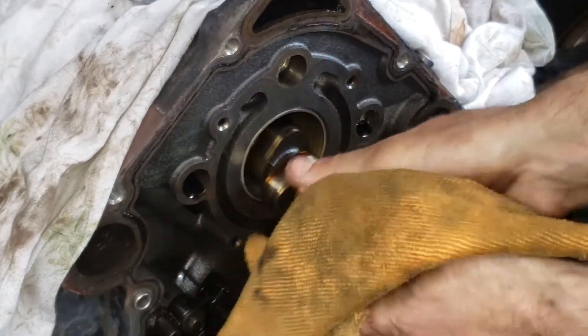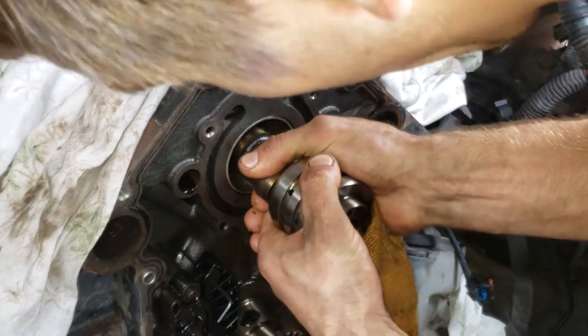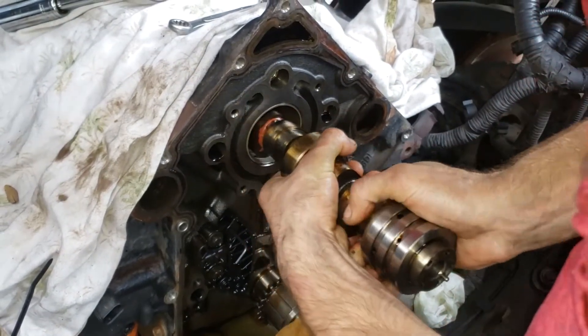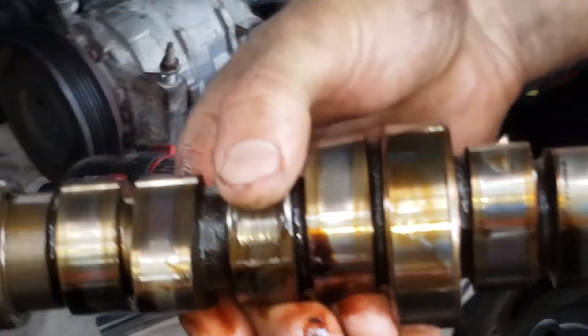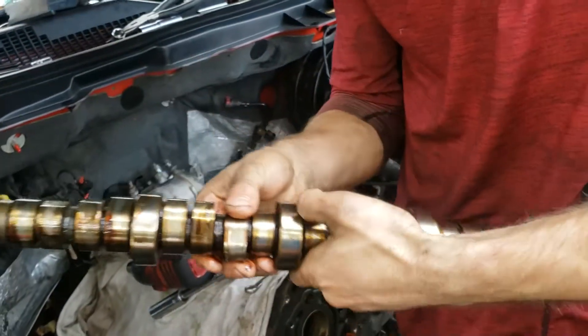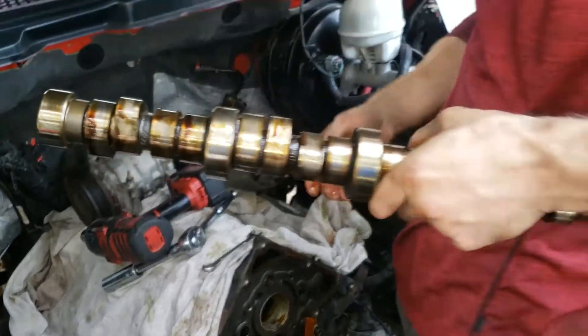Looks like I have to turn it out. Nice and easy. The first one is here — so we have a couple of them. Cylinder eight, you can see the lobe is a couple millimeters off already on this one, another one right here. Which is pretty bad, doing some damage here. So we have two bad ones here and another one — let's throw a new camshaft in and wrap it together.